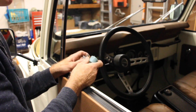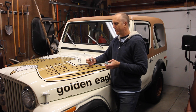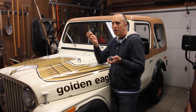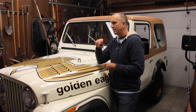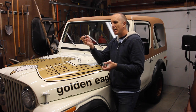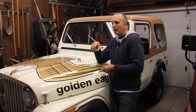So I can't tell you specifically what problem was solved when I did one thing. My guess is it was a combination of a few things: bad grounds, inadequate fuses, and replacing worn light bulbs that weren't getting good connections. This may not be exactly what's happening to you, but my guess is that any one of those scenarios you're probably experiencing. I'm not saying the fuses were the problem, I'm not saying the ground was the problem, I'm not saying the light bulbs were the problem — I'm saying it could have been all three. The reason I spent so much time on this is because I was only testing one thing at a time. The CJ7 electrical system, although fairly simple, is really based in the grounds — and you're dealing with 35 to 40-year-old pieces. Get yourself a good voltmeter and go through the process.